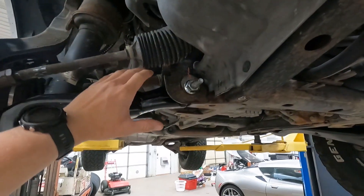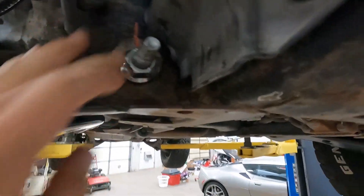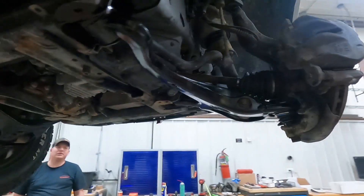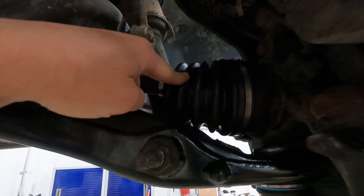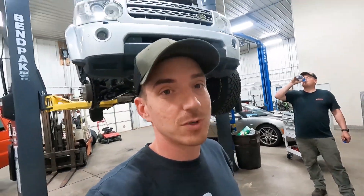It's going to go down to a complete off-road shop for an alignment afterwards, but we marked out where it was beforehand so it'll roughly go back into about the same position. We've got shiny new arms and a nice fresh boot — the sphincter stretcher is a good tool.